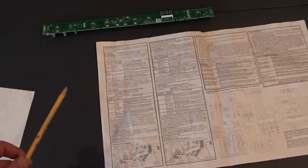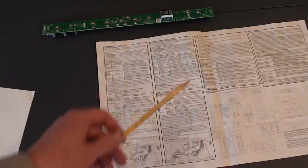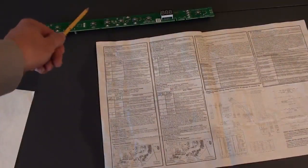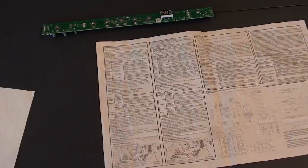There's another section that describes different settings on your dishwasher and how the service LED should be flashing — one flash to tell you this, two flashes to tell you that, up to eight times. Based on getting these flashes from the controls I was pressing, I was able to find out that this circuit board was bad and the other circuit board was good. I ordered this part, put it in, and my dishwasher is back to working normally.